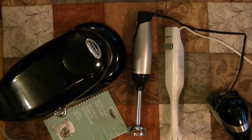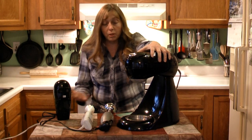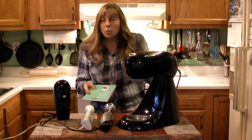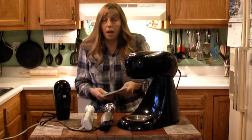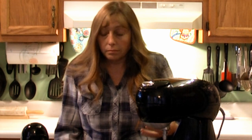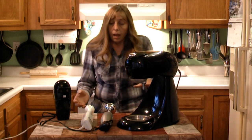Too much heat will completely destroy your electric motors. Now this stand mixer sells for between two and three hundred dollars depending on where you buy it. Nowhere in this owner's manual does it say a word about duty cycle. But if I go out in the garage, we have a drill press that has the duty cycle in the owner's manual, a welder that's probably 50 years old with duty cycle printed right on it, and most hand drills will tell you the duty cycle when you buy them. Why kitchen appliances don't have that in the manual, I do not know.